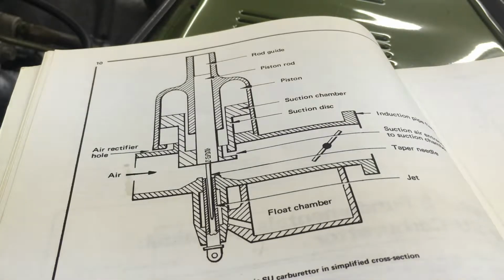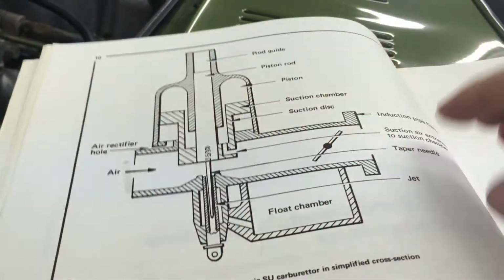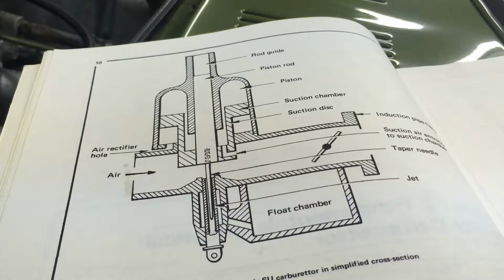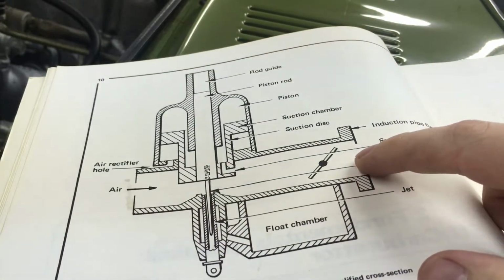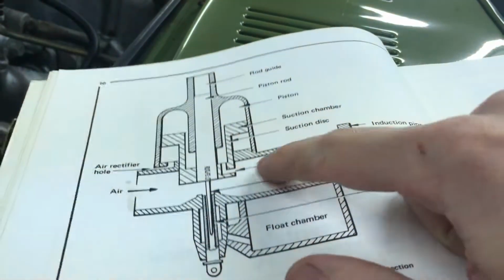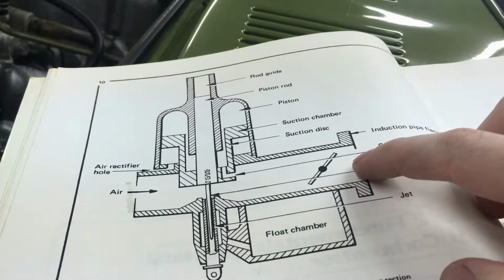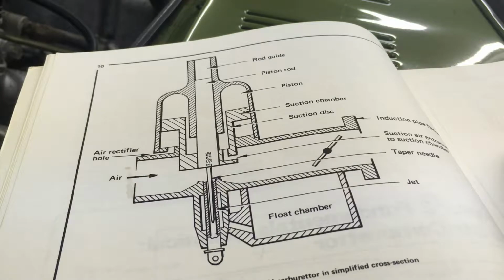So the next important thing to remember is that on this side, this is where it's connected to the engine. So the cylinder is moving up and down over here, and it's essentially a large pump, and you can think of it as just pumping air directly out of there, because of the rising and falling of the cylinder. So as you would imagine, this point right here to the right of the piston isn't in a whole lot of communication with over here, because like I said, that butterfly is almost shut. This is going to have a very low amount of pressure because it's sucking all of that air out of it, and it's getting close to a full vacuum. I mean, 100% vacuum is pretty rare in reality.